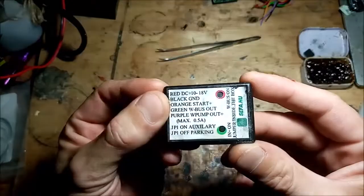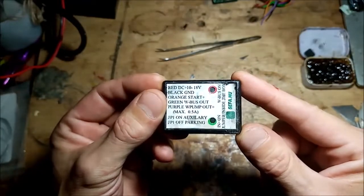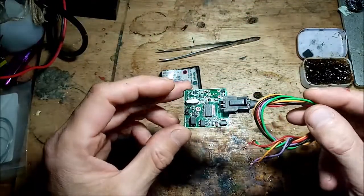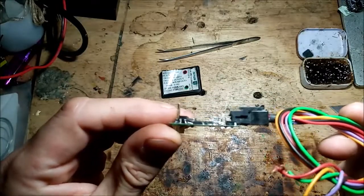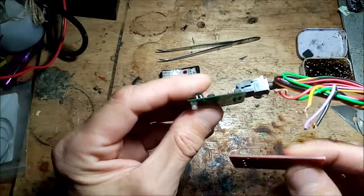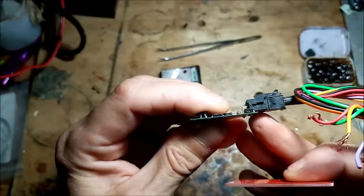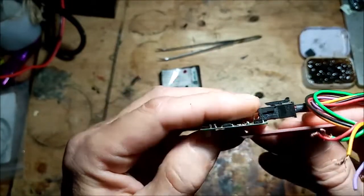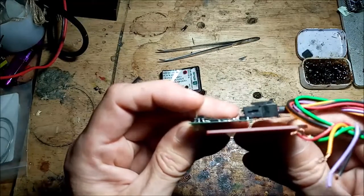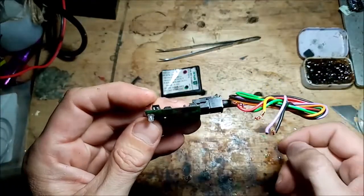Now this particular type - the one David McLuckie reviewed. We took it apart so he didn't have to, and thank God we did. Here's your board. See how thin it is? Let's show it up against good quality real circuit board. It's bending - it's got bend gate going on. Look how thin that is. This is standard 1.6mm FR4. It's as thin as a sheet of paper. That doesn't mean it's bad; it just means it's very, very cheap.